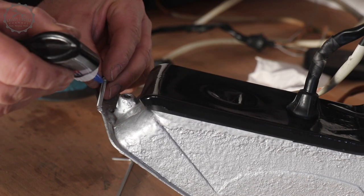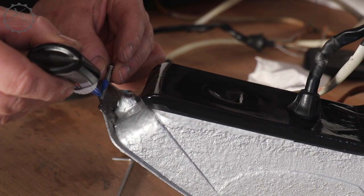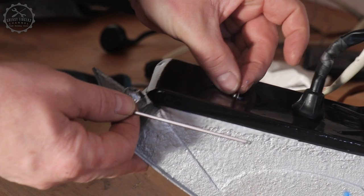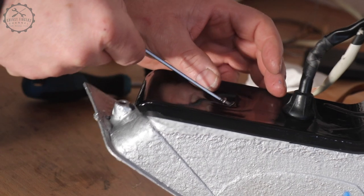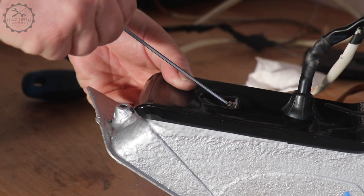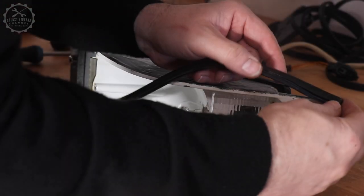Whenever a 911 drives through rain, these screws are exposed to the water raised by the wheels, so it really screams stainless steel. Stainless steel screws, however, in connection with the aluminium housing, is a very bad idea because of contact corrosion. I know I'm literally playing with fire here, but it tempts me so much to find out whether the thread lock liquid will help avoiding the problem. I'll have a look in a year and I'll let you know.